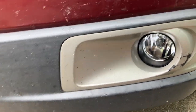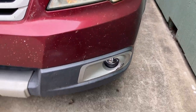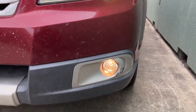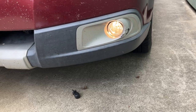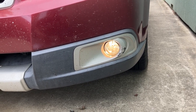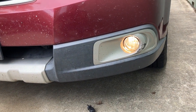New fog light installed — let's see if it turns on. All right, there we go. Fog light's working. I hadn't connected it quite right but I got it — it's on, it's good. So before you put the splash guard back, don't be like me — don't assume the light bulb will work. This one does work, we proved that. Sometimes the bulbs that these come with might not work; it's happened to me before where one of the bulbs was just burnt out from the factory. So make sure it's working, then put everything back together. Repeat the same on the other side and you're good to go.